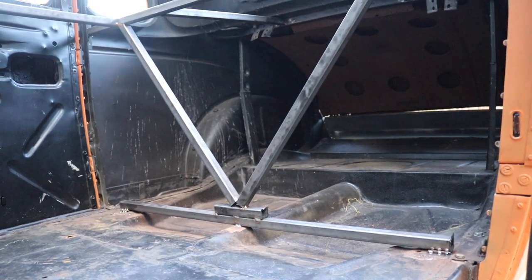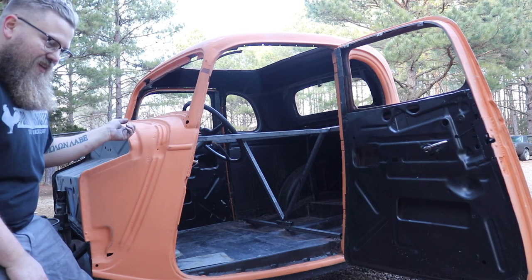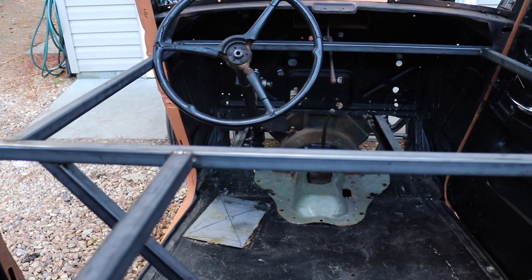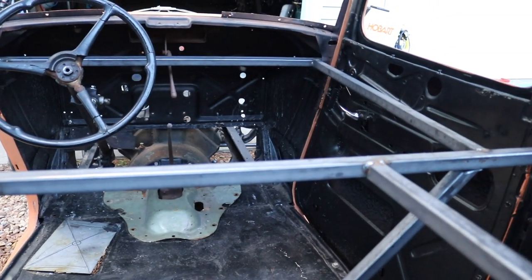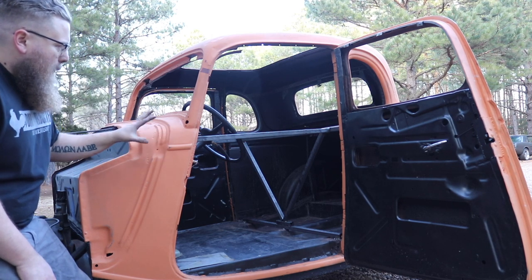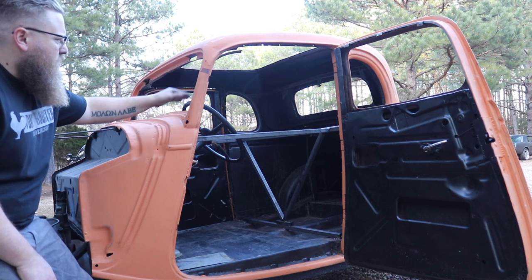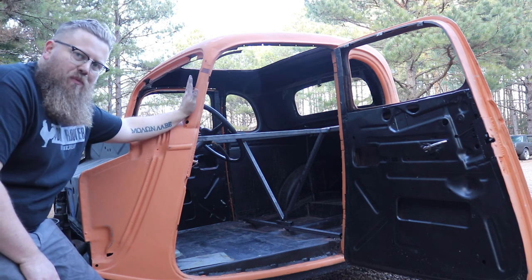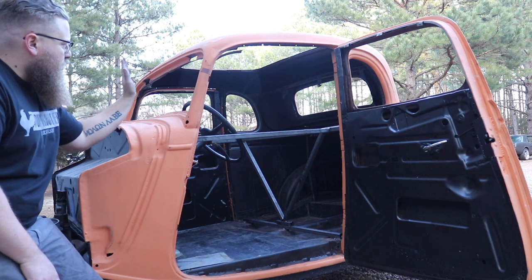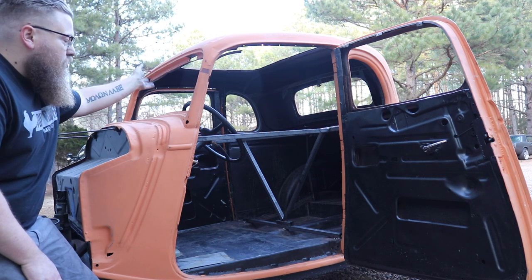I think that's extremely important. On this body style, I took the dash off and welded a bar across where the dash was, because there's not a really good spot to weld our door bars to otherwise. I like doing it this way because now I have good structure going across. Another really important reason for that dash bar: on this body style, when you start pulling the chop down, you want to lean the A-pillars back. To do that, you cut all the way across the cowl so when you tilt the A-pillars back, the whole windshield surround tilts back with it so the windshield sits nice and flush on the front.